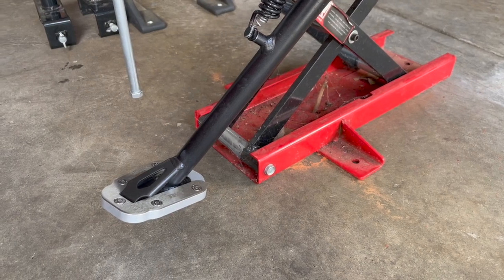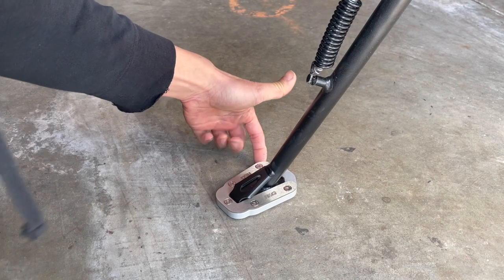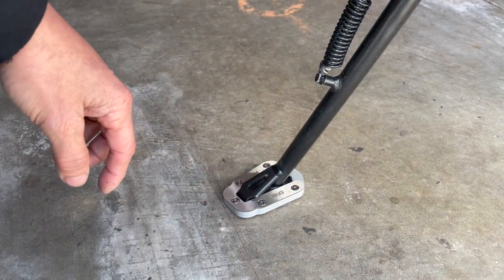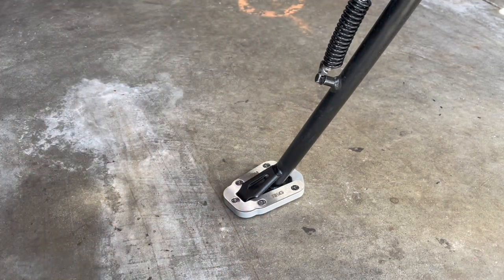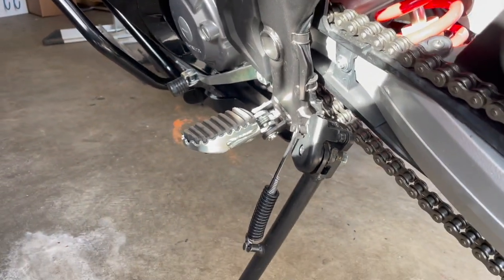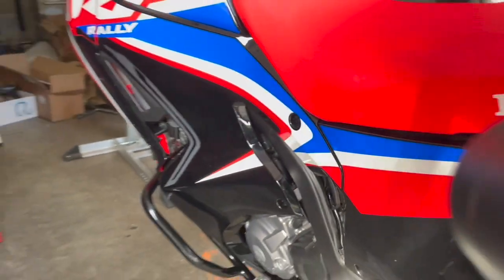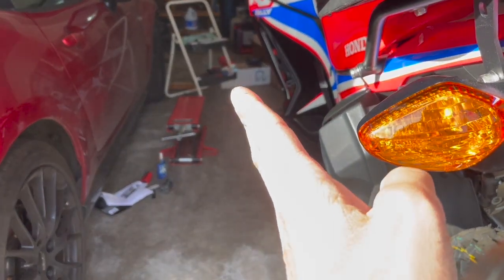It's on the side stand now. As I said, it touches the front corner up here — all the back here is kind of lifted up until about this section, which is touching towards the front corner. Because of the thickness it actually raises the back a little bit, which is good. I have a new rear shock, and I'm going to put in front springs soon because the factory springs are pretty soft. The soft suspension makes the bike lean even more when parked.